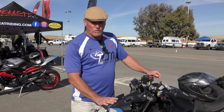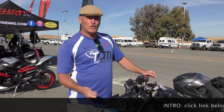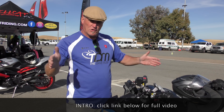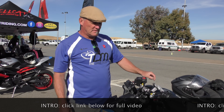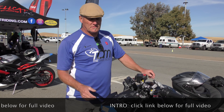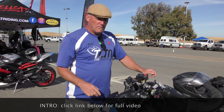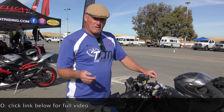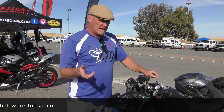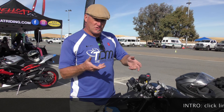When we've got a bike set up for the owner, it's never going to stay the same. Because as oil ages, it changes its viscosity cold to hot, and that grows tremendously. So for about somewhere around 800 to 1,000 miles, the bike will stay very balanced, very consistent. But if you push and go hard beyond that, then rebound in a countryside environment with relatively smoother roads where you go a lot faster will start to reappear.